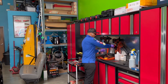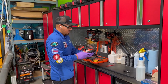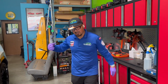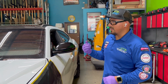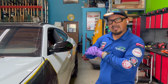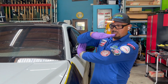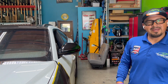If you're having problems breaking your line, it's how you manage your line to run. If it runs too low to the body, that becomes pretty difficult, you're literally pulling. You're not so much cutting, you're pulling. There's going to be a lot more resistance between the body and the urethane versus the glass and the urethane. That is your sweet spot for the fiber line. And the angles, you always want to see the end of the tool facing, and the lower the angle, the better. So I'm gonna get this window out and I'll be right back.